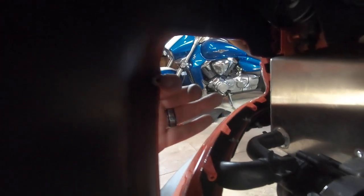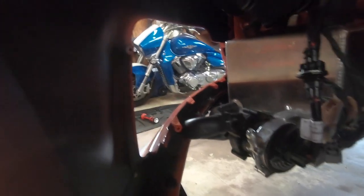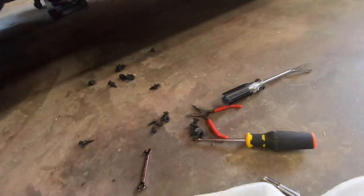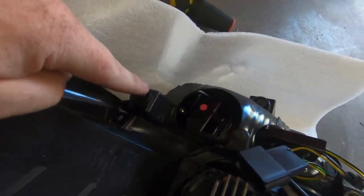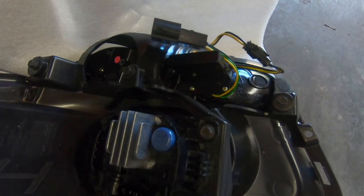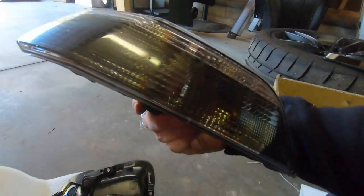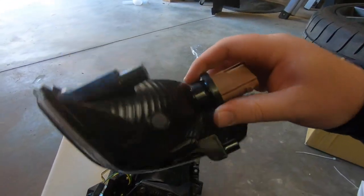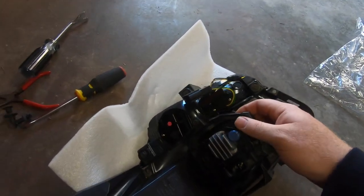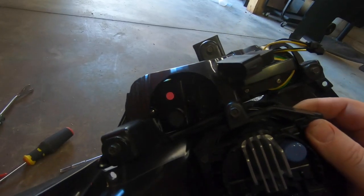There's a tab there, a tab there, a tab there, and a tab there, and those fit in those notches. Your bosses for the screws are here, here, here, and here — so there's four screws and four clips or tabs that hold that whole assembly in. You get the whole assembly out, then swap out the turn signal piece — these four screws come out — and this whole assembly comes out. The new assembly I have is the new OPT-7 light. I took the four screws out, removed the old stock turn signal, put the new assembly into the fog light housing, and tightened those down.